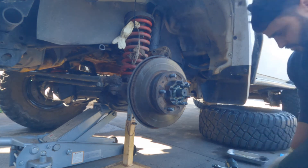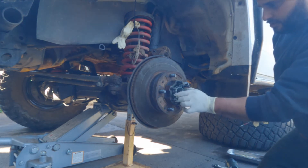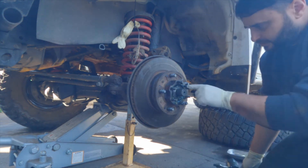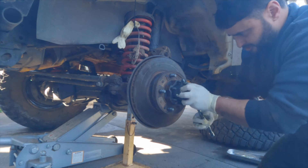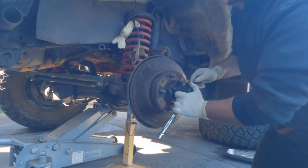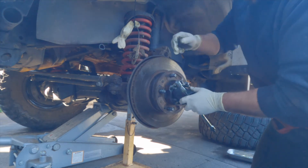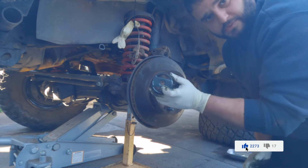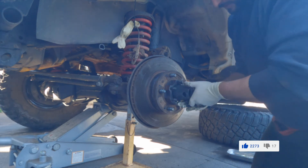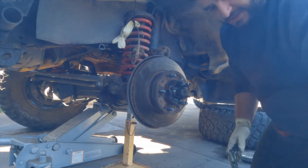Then you've got a screwdriver — go ahead and remove the lock washer. You can see there's a tab bent back. And then you've got another locking nut; this one should be a lot looser. Also, a little hot tip: if you buy one of these sockets, don't buy one like I did with the 3/8 drive — get a half-inch drive, so you don't end up snapping them when they're really tight. Alright, so that's the other one off.